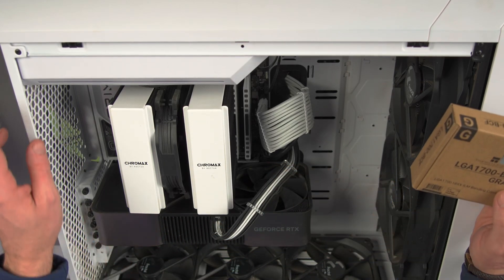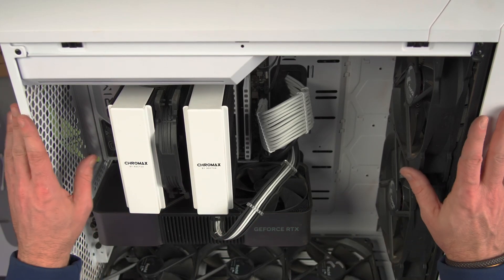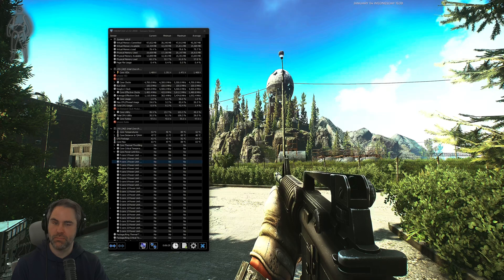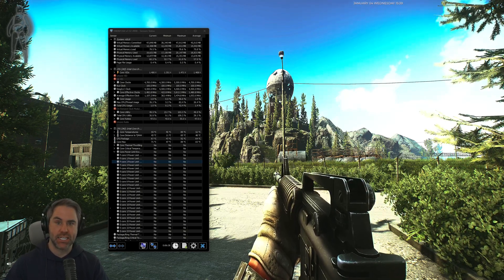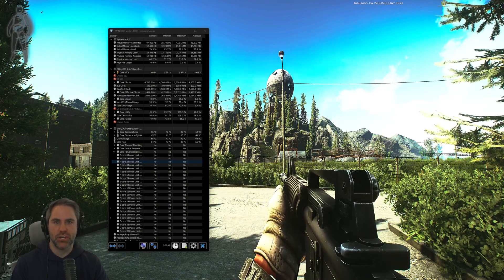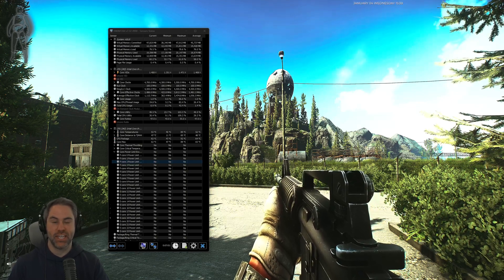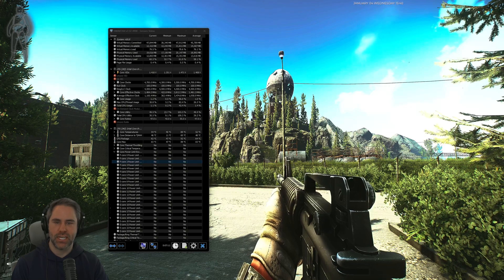And that is how you put in the contact frame onto your motherboard for the 12th gen or 13th gen Intel CPUs. Hopefully now we'll get some better temperatures. We've been running Tarkov for about 20 to 30 minutes, and the CPU package temperature is anywhere from 59 degrees up to a high of 71, with an average of 64 degrees Celsius. That alone is an 8 to 10 degree improvement by adding the contact frame. I highly recommend it — it's fairly cheap on Amazon and worth it for LGA 1700 socket CPUs. I hope this video helps, and if you like the content, please hit that subscribe button. Hope you all have a wonderful day — cheers.